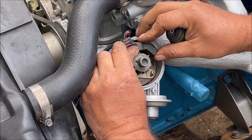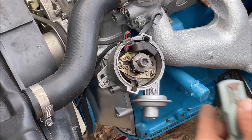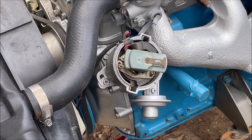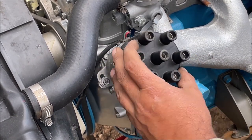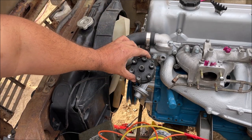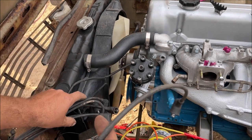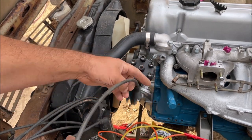Make sure it doesn't hit. Number one should point to the front but it's actually a little bit down. I've got six right here so we can put six on — firing order is 1, 5, 3, 6. Perfect fit.